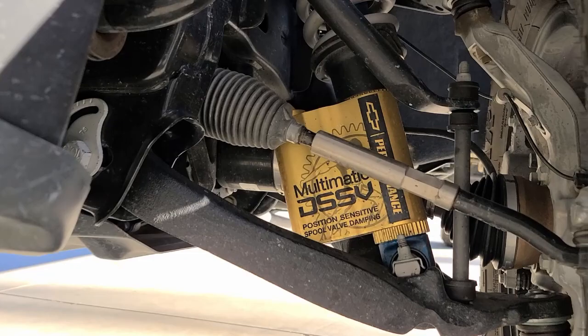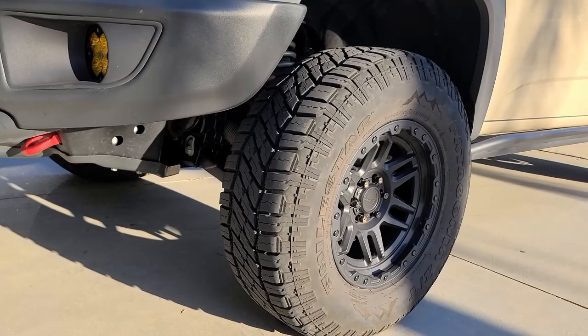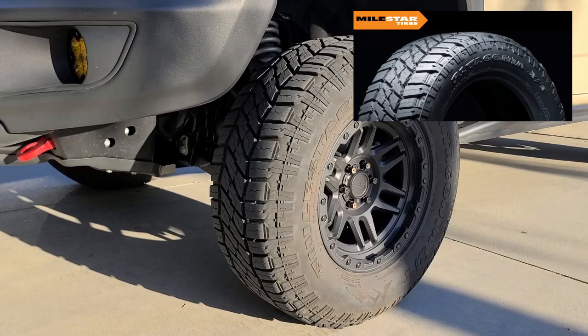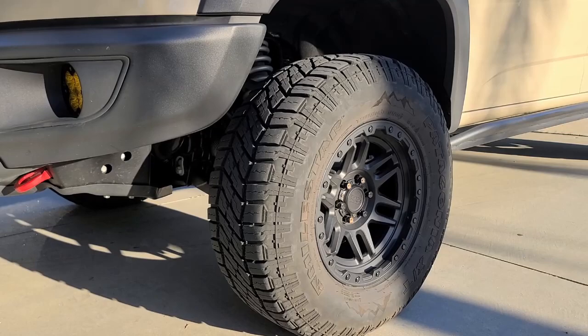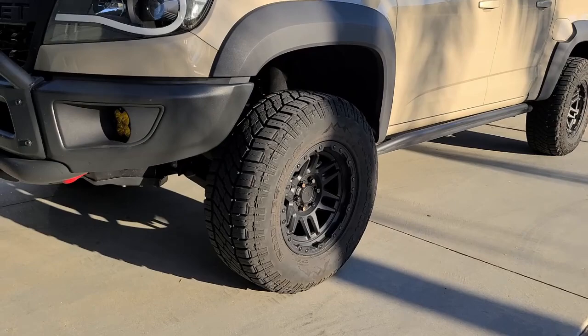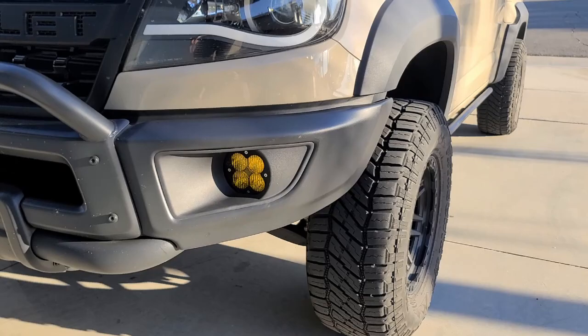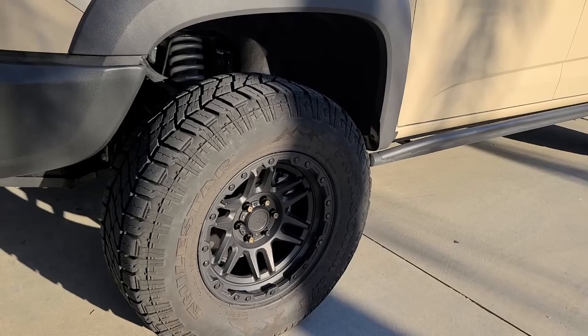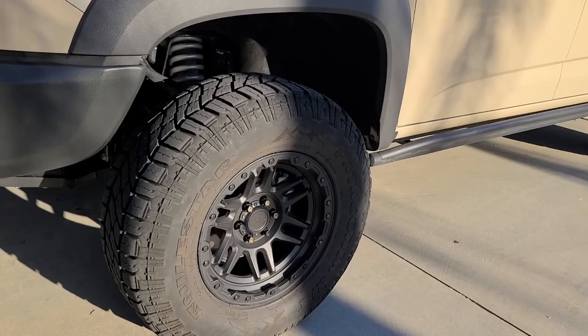The biggest other change to off-road capability has been the tires. The Milestar Patagonia XTs were probably the single largest component to making my ability to get off-road where I wanted to go. The 33-inch tire is probably the largest you can put on without a substantial suspension upgrade. The zero offset gives a wider track base but does complicate turning radius. I did put in an AEV 33-inch trim kit, which is pretty much a necessity — whether you have the Bison or the standard ZR2, the kit works for both.